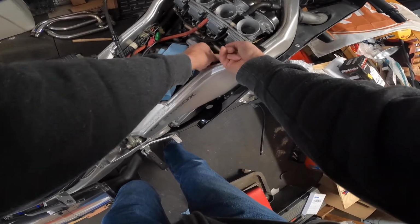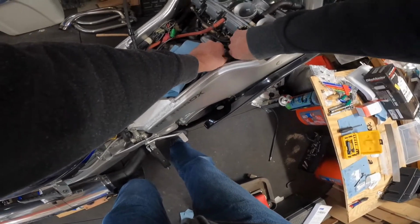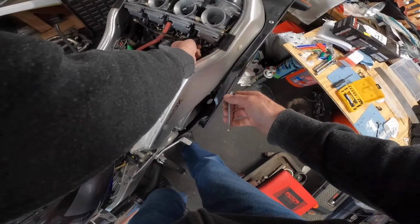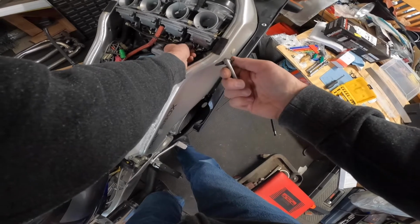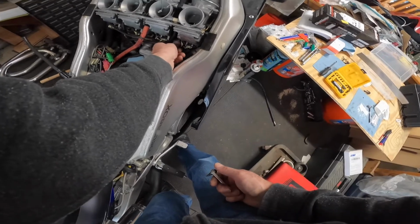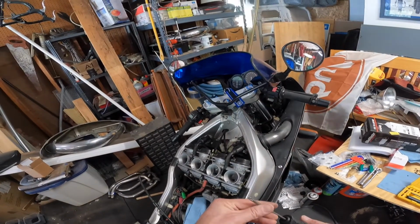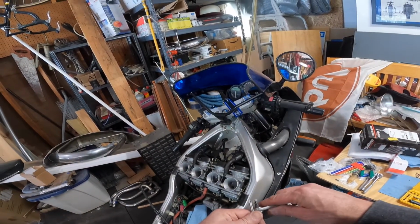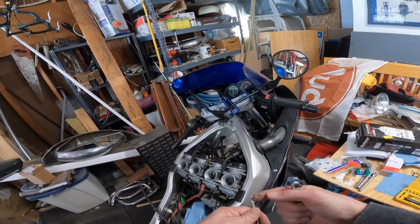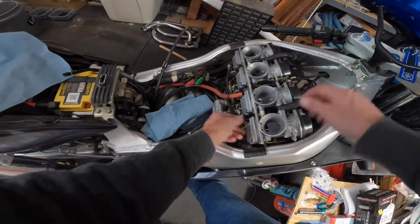These Phillips heads or JIS screws, they strip out so much more easily. I know you're going to say I'm not using a JIS screwdriver here, and I'm probably not, because I don't happen to have those tiny bits for those. The one I do have, like this one's Japanese Industrial Standard. It's different than a Phillips, because a Phillips is tapered towards the point, where these separate blades are straight. And you get much more torque with those. All right, so that's looser now.